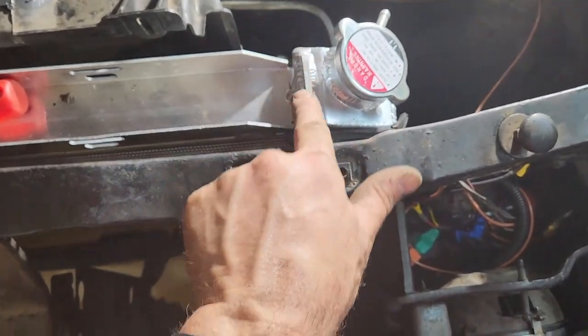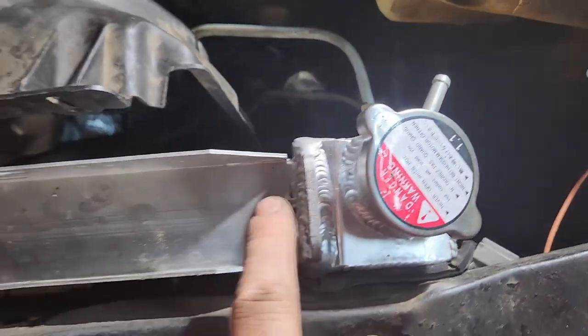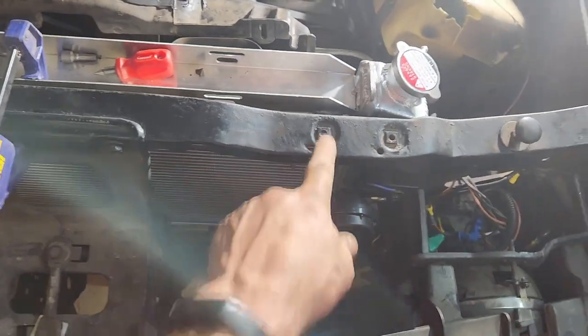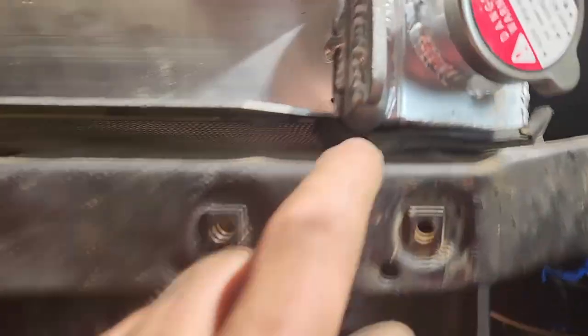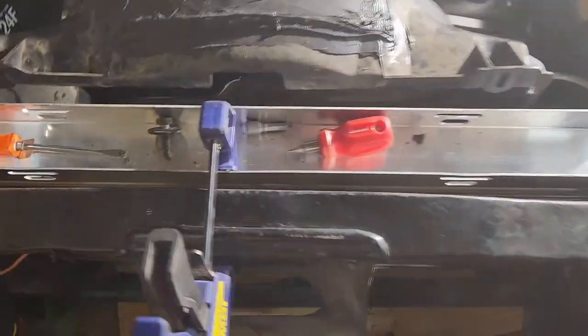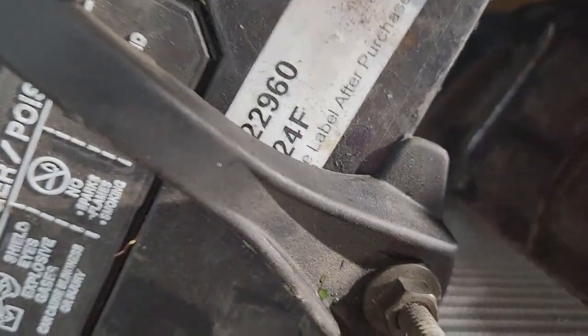We've had to do some changes. These big mounting pieces are kind of causing the issue, especially on the bottom — it wasn't sitting down low enough. I had to move it over to the left a little bit, and none of our mounting brackets are working. So I'm going to have to make some custom mounting brackets. I also put rubber from the original mounting brackets behind here to hold it tight against the rad support without any rattling, because my hose was actually against the belt. I needed the top to push out a little bit to get clearance on that hose.